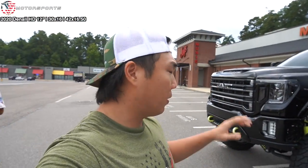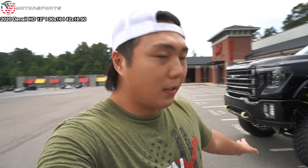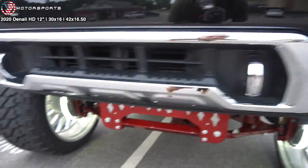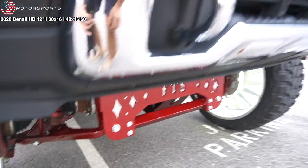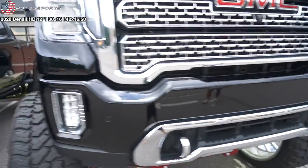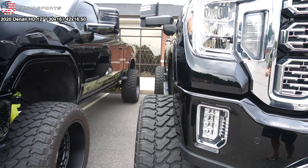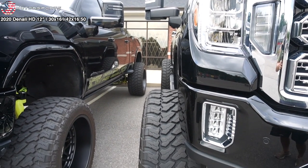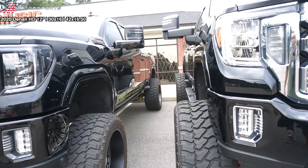Normally I'd put a 2 inch wheel spacer in the rear to match the front track width, but with my truck I didn't have to do that. The first thing I noticed on this FTS 10 to 12 is it has a CV axle spacer on one side and another one on the other, which does push the track width out a bit more. The front sticks out probably about an inch and a half to two inches more than the back.